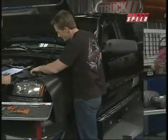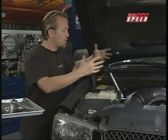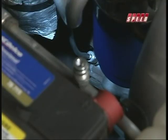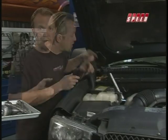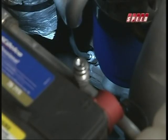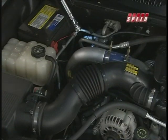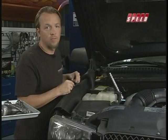Yeah, pretty easy. One of the first things that we had to do in the installation of this EconoMind tuner was come over here to the exhaust manifold and drill a hole and tap into it so we could plug in our EGT sensor, and that's going to help us monitor the exhaust gas temperatures. Then we could put in our little fitting. That way our EGT sensor will plug right into that. We're ready to go, monitor the EGTs. Now we can sneak up into the cab and see how we're going to monitor this whole system.